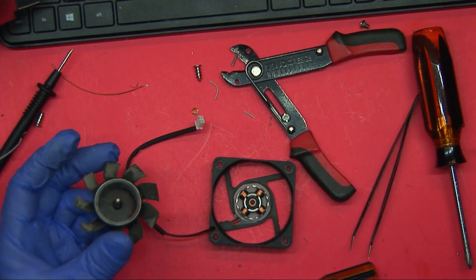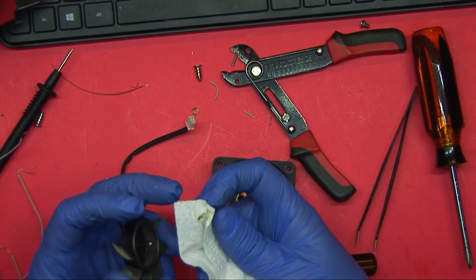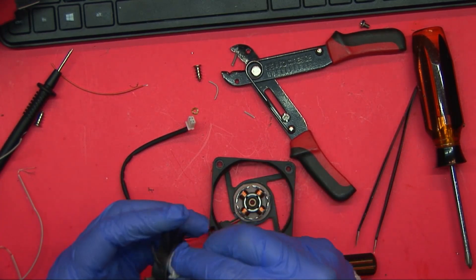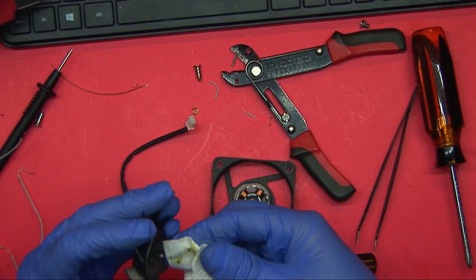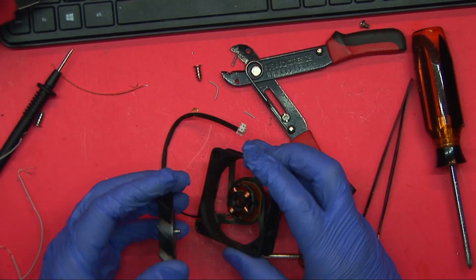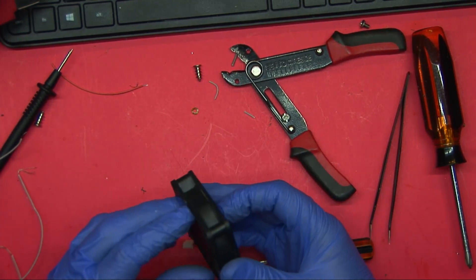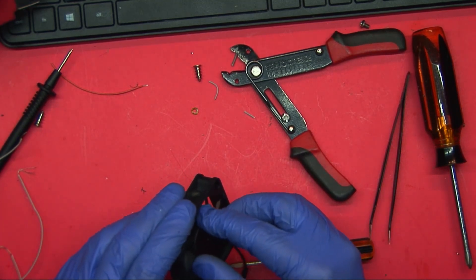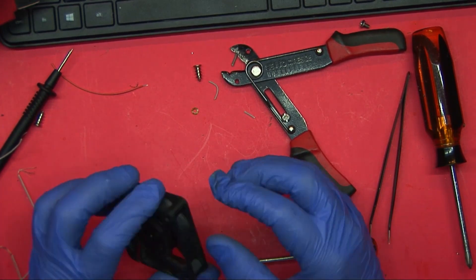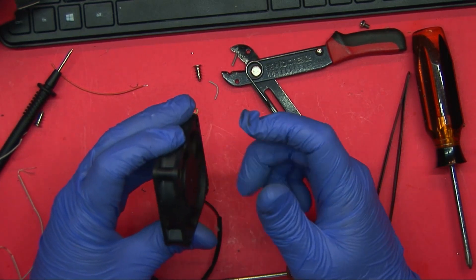Here's what I think happens with these cheap fans: they use very thin lubricant, it all spun out. Dirt got in — because it's very dirty — and this shaft has just been running through this bushing dry. There's some play in there now. So when the fan's cold, it just rocks around and rattles in there until it warms up — until everything heats up. Metal expands and suddenly it rides nice and smooth.